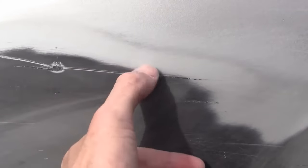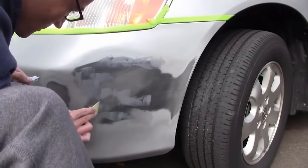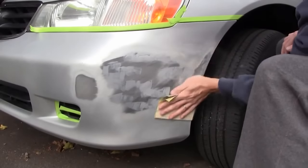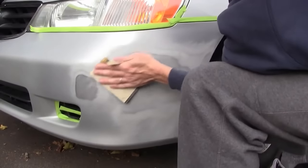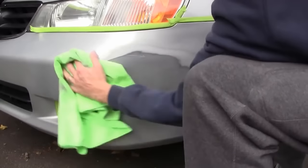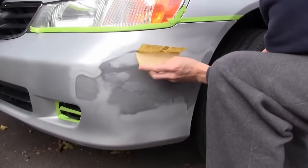You might find that some of the scratches won't sand out, and you'll want to apply a thin layer of scratch filling putty with the supplied plastic spreader. Again, wrap sandpaper around your gray scuff pad and sand with firm pressure over the putty. Sometimes you'll find that a second application of putty is needed.